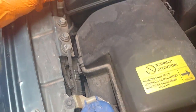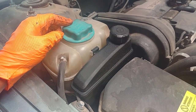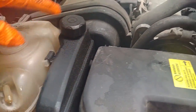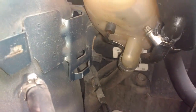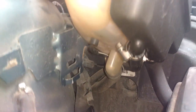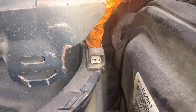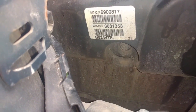Next, lift this cluster of things out of the way so you can get to that 10mm front cover bolt there. Unhook your line here and be ready to pull some of this out. I'm going to drain the coolant out of the system since I'm doing the water pump as well. Coolant drain should be right there — 13mm. Remove the cap, pop this hose loose, and remove this hose. Now I can lift this bottle and power steering reservoir up and out of the way. Lift this up and be extra careful not to damage the wire for the sensor — I'd recommend unplugging that wire. The latch for that sensor plug is on the back; I pushed it in with a screwdriver, unplugged it, then pushed everything up over the ridge. Now I'm going to get that 10mm out, undo it, and pull this cover off.